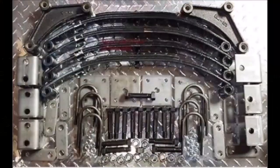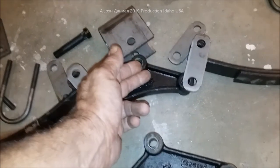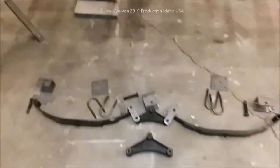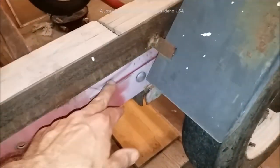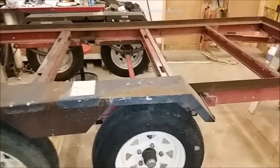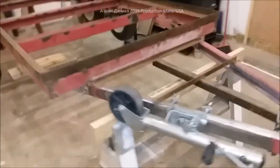This is an equalizer for an up to 5,200-pound 1¾-inch spring, and it works great. So I'm going to have a capacity of about 3,300 pounds. With this 2×2 angle on here and welded, and the frame boxed where it might have had a weak point — and this was continued the whole length under there — so it's not going to break in half. I've had a cord and a half of wood on this thing 15 times. Ain't broke yet. I'm not running up and down the interstate, except once — I did take it down to Baker, Nevada.